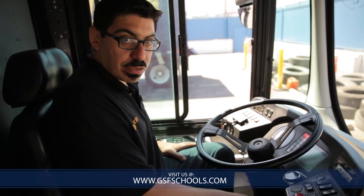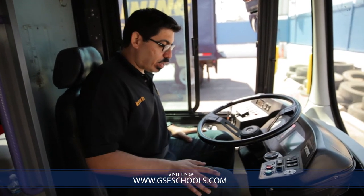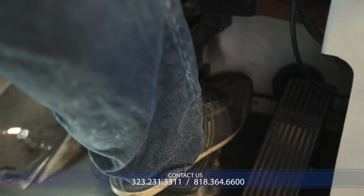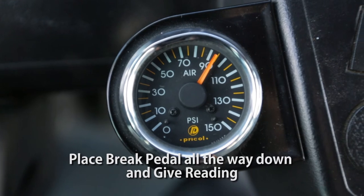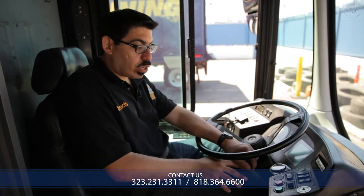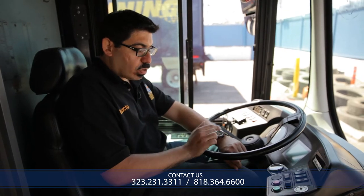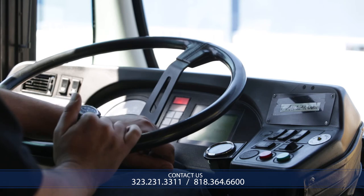Now I will apply pressure to the foot brake for one minute. In that minute, as I said, we cannot lose more than 3 psi. I'm going to press the brake all the way down — it's important that you press it down and keep it down. At this point, you're going to mention what pressure you're currently at. I happen to be at 93 psi. I will tell the examiner: 'Sir, I'm at 93 psi. My minute begins now.' It's important that you wait the whole minute — you can even wait a couple of extra seconds to make sure the examiner agrees the whole minute has passed.